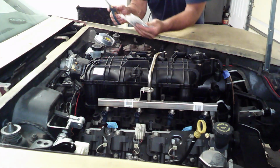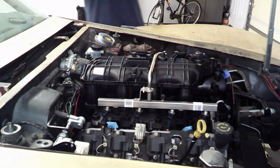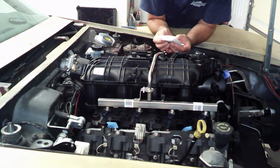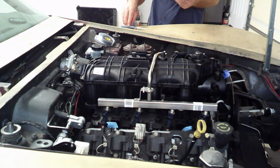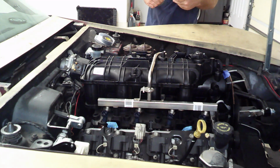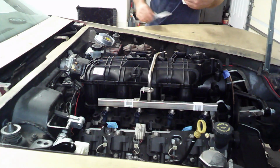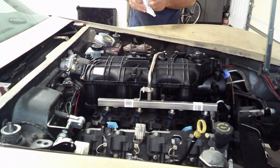So I got this bolt kit from ICT Billet. It is part number 56729-84400, and actually I think that's their internal part number. It's a 551400. It comes with the bolts and the washers. They say that if you're replacing a truck manifold with the Trailblazer SS, you can use the old bolts. You just have to take the grommets off of it.